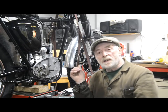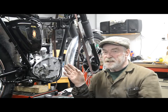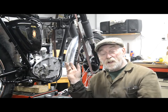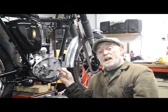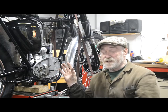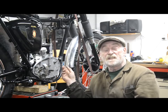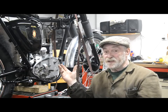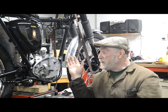What else? Oh, I had a mention about dry clutch plates. Don't worry about that. Clutch material now is completely different to the cork, which you used to soak. And anyway, as those of you who watched me before will know, before I ever start to run this engine, I'll have kicked it over to get oil right round to the rockers. And by that time, the clutch is well oiled. I make sure everything's lubed before I start. Perhaps if I put a brand new dry clutch in, wheeled it outside, took it up to maximum revs and did sprints up and down the drive, it would affect it. But you can build your clutch up dry, which makes it a lot easier to do because you're not getting clarted with oil. And then just put your oil in and kick it over a few times with the clutch plates open, and it'll be fine.